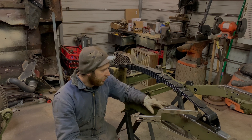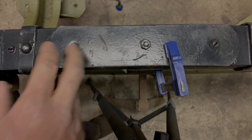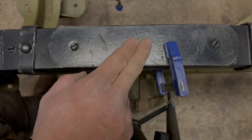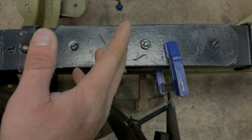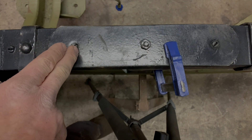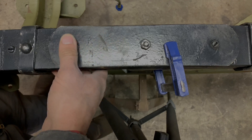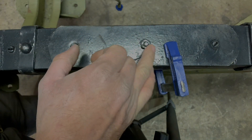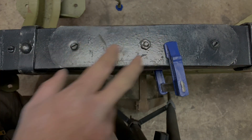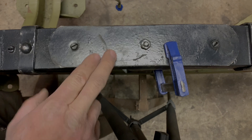I figured out what to do with my axle location problem. The center pin basically needs to be moved over. They have axle mount weld-ons that weld onto the axle with a hole through it so you can reposition the axle — you shouldn't move it too much because it messes with geometry, but a little is fine. I'm going to nibble off the end, take out the Teflon slide, and make a new hole, then put on my axle mount. That will cure the trouble and keep the 80-inch wheelbase while letting me use the longer spring — a win-win.